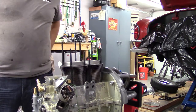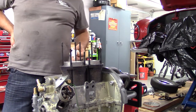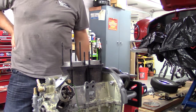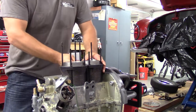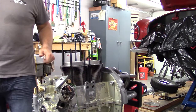So now we've got our 20-thousandths extra deck space. That's going to put my total deck at about 79 thousandths, which is going to drop me a couple tenths of a point of compression — which I'm not all that happy about — but rather safe than sorry. I'd rather have a smoother running motor. Rock them a little bit to get that Permatex seated nice, and now I'm going to get the head on and torque that down.